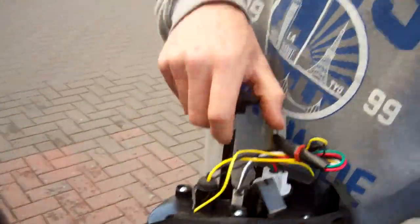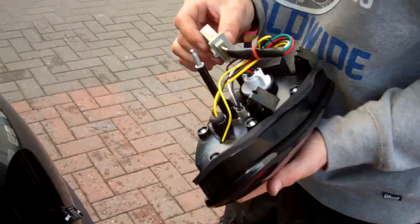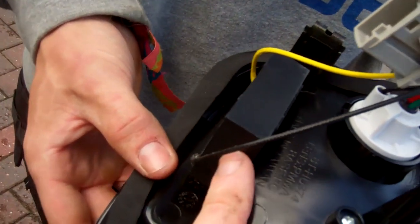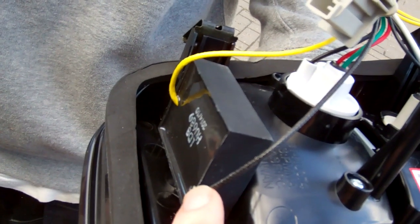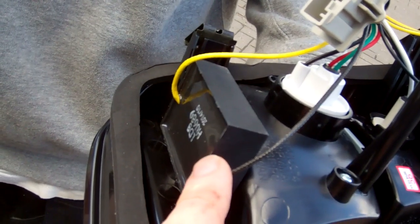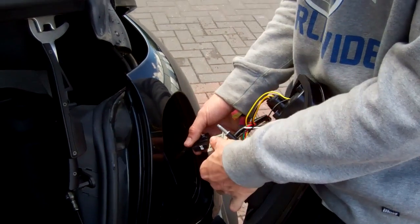And there's the new lamp. It comes with a protective bit to stop you poking your eye out and damaging the lens in transit. One point to note: when you put LED lights in your car, you do need a resistor to stop your indicator flashing too fast — like when your bulbs have gone — because LEDs take a lot less current. These lights come with an integrated resistor pack built into the bottom, so they are plug and play. You can just put them straight in.